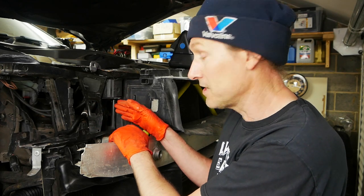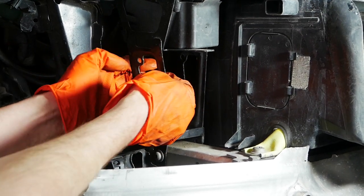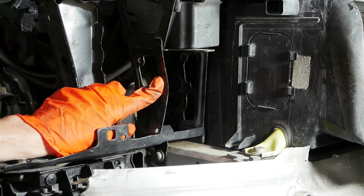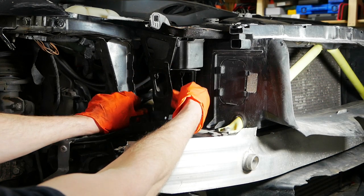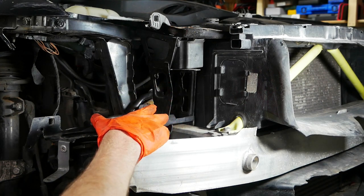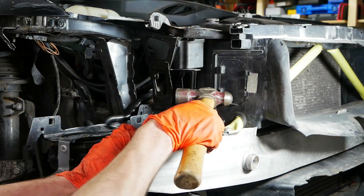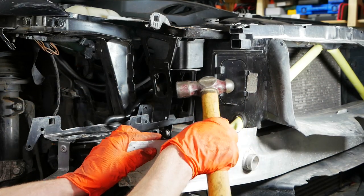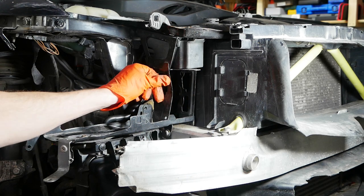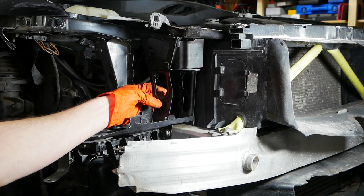This might look thin and flimsy and easy to straighten out, but I've had a good pull on this by hand with no luck at all - it hasn't moved even a millimeter. So I'm going to pull this out with a slide hammer. If you wanted to get behind there and tap it out with a normal hammer you just can't get in with it, and if I tried to lever it I'd start to bend the front beam rather than the rear one, making it twisted. So it'd be pretty awkward.